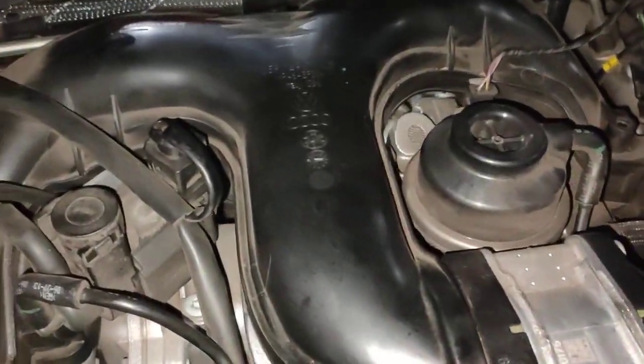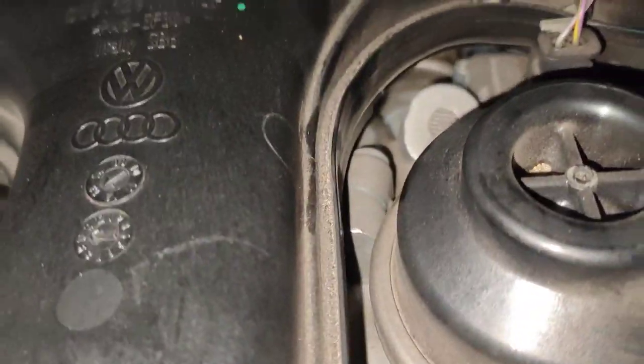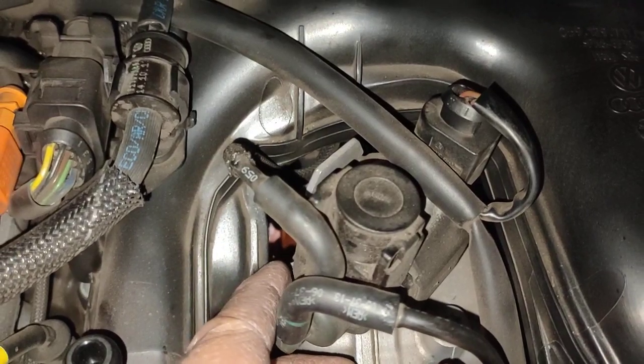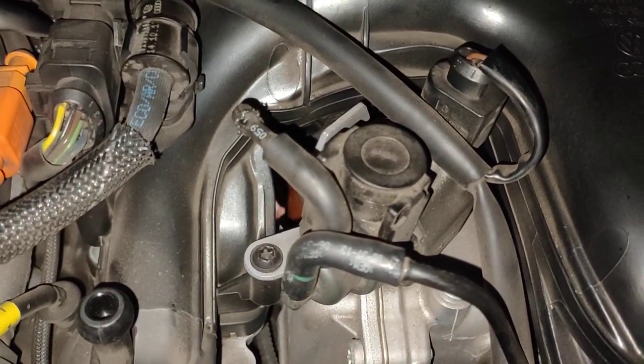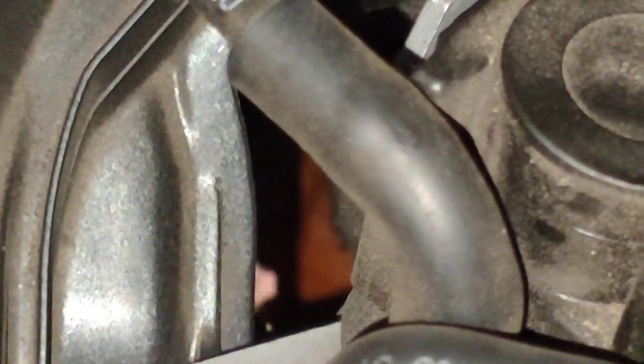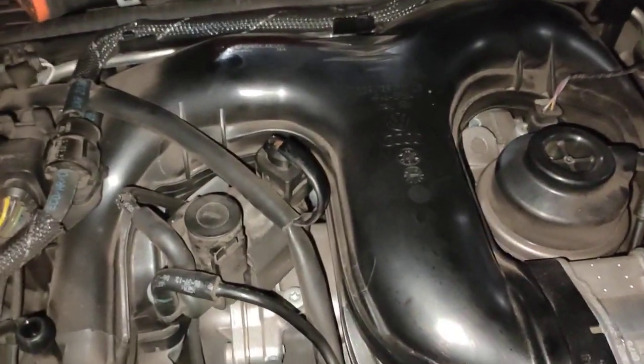Because you can drive this car and it's ready to just get worse. If you drive more, it's going to leak even more. As soon as you see coolant inside there — see here, right there, there's your coolant right there. The valley is full of coolant, and the only way to do it is take this intake manifold off and go from there.